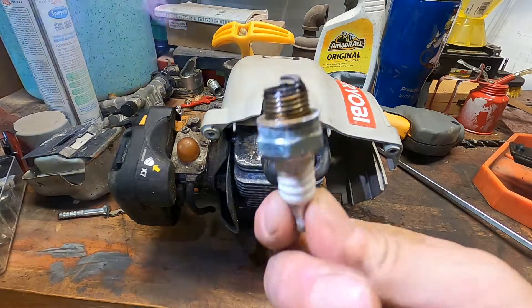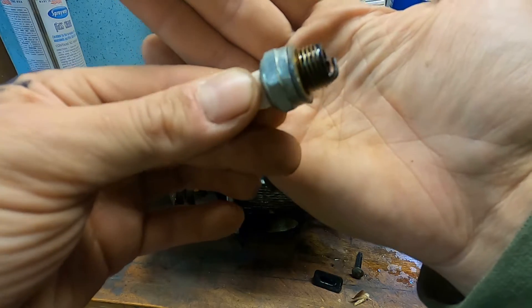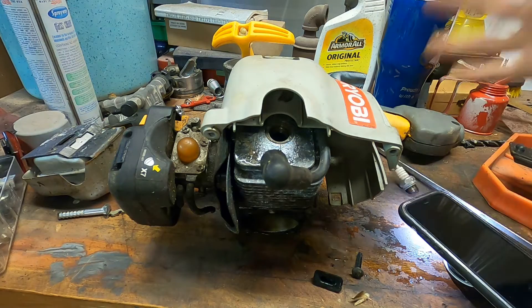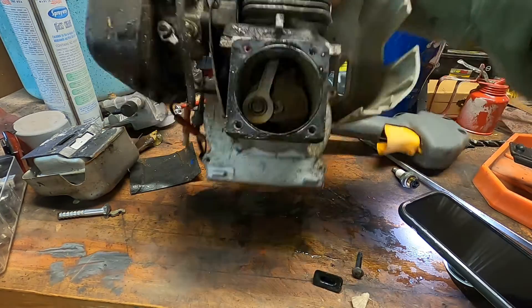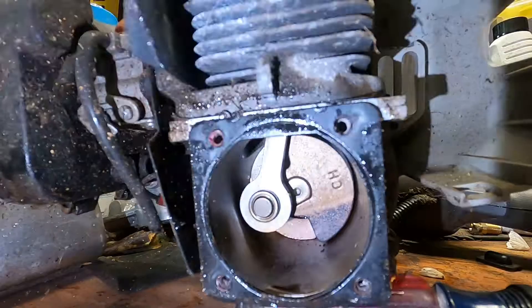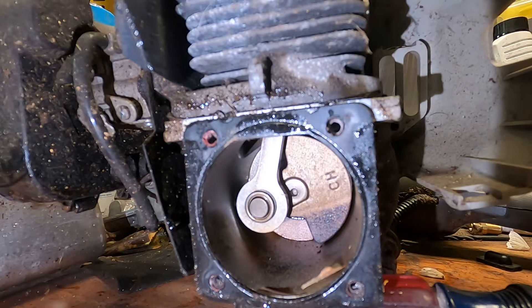We pulled the plug. She's dirty, but no signs of mechanical damage or being run without oil. In fact, it's pretty well fouled — I think it was definitely run on mixed gas. So what could have happened to this thing? Why did it seize? You can see down here, we pulled the crankcase cover off, and I'm pushing as hard as I can on it — it's not budging a bit, but there's no sign of damage. So I have no reason to believe that it's anything more than the piston stuck in the cylinder for God knows what reason. I can't find any indication that it should be seized.